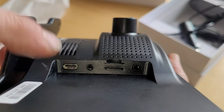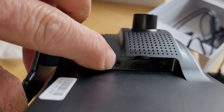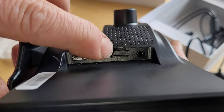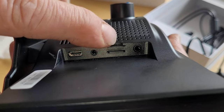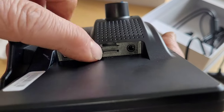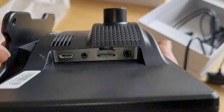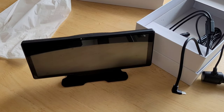On the back: USB-C connection which as I showed goes to the power cable; AV in which goes to the rear camera; an SD card slot — it doesn't come with an SD card so you need to buy that separately, it takes up to 128 gig, I've put a 32 in there; and a GPS antenna input — that doesn't come with it, you can buy it separately, but we won't need it because CarPlay and Android Auto handle navigation through the phone anyway.